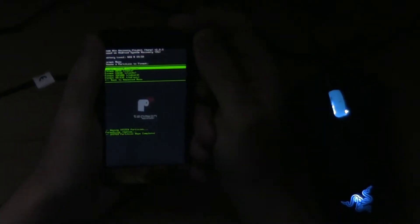So what you want to do first — if you're in Team Win Recovery, go into the Advanced Menu and wipe the whole entire phone except for the SD card. Go ahead and format system, let that format, then do data. Now this ROM will format your phone anyway, so you don't have to do this if you don't want to, but it's always safer to wipe it yourself so you know 100% sure it's clean.